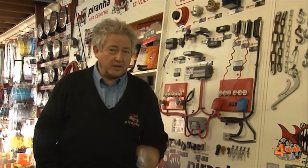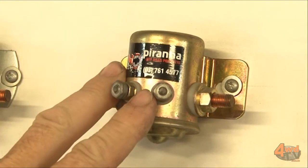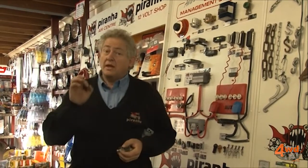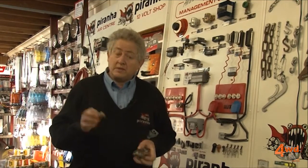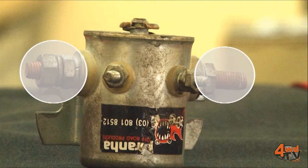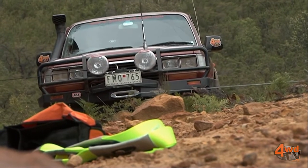I've actually brought one I've prepared earlier — here's a solenoid. What it looks like before it's been pulled to pieces is one of these things; they look like a little tin can. A solenoid is like a dirty great big version of a relay — by putting a very small amount of power through the two outside terminals we're able to transmit enormous amounts of energy. Typical uses would be things like an electric winch or a starter motor solenoid.